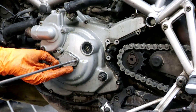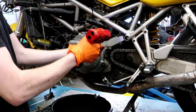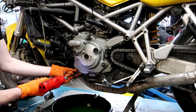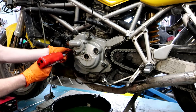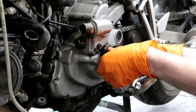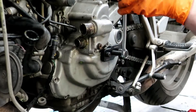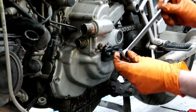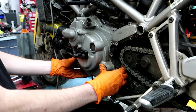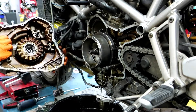Once you get that little cap off, we install a special Ducati tool. After you get all the perimeter bolts out — they just seal the cover to the engine — you bolt this little mechanism onto the alternator cover itself, wind it in and it pulls the cover out evenly. Pop — releases some of the engine oil that was sitting up at that level. Then you give it a wiggle and a jiggle and it just comes free, revealing the clockwork internals.